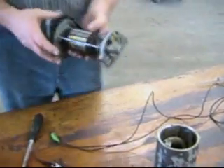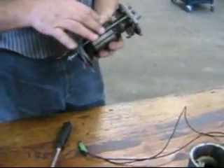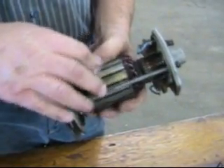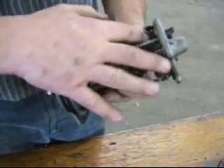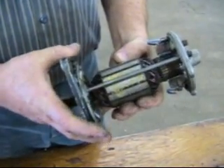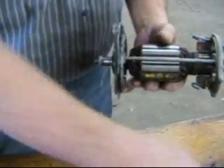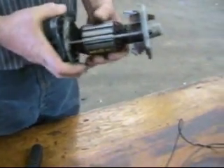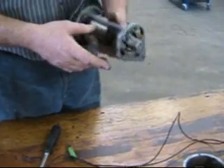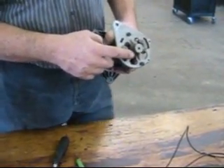So that's the field. Now here's the armature and brushes. The armature has 28 segments along the side with a couple of wires wound around each one. Each time it comes around and hits the brush, we complete a circuit, and each time it moves one fourteenth of a turn, we snap some lines of force on the magnet and induce a little bit of voltage into the armature, which is picked off by the brushes. One brush goes right to ground, the other comes up to the isolated D terminal — D for dynamo.